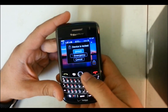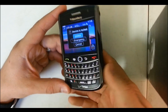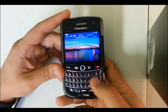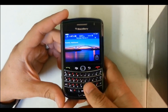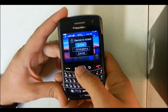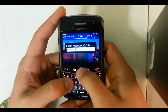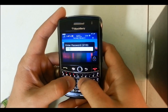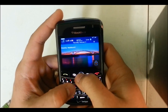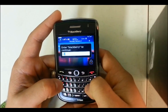In this video I'm going to be showing everyone how to factory reset your BlackBerry. This one is the 9630, but it's pretty much the same for every BlackBerry or most of the older BlackBerries. If you have a password on it and you can't get into the phone, this is how you reset it. All you have to do is put in the password incorrect 10 times and it will automatically wipe itself and erase back to factory settings.